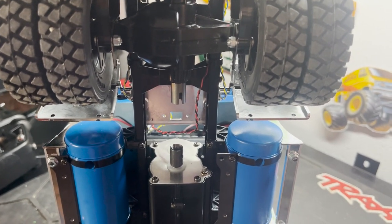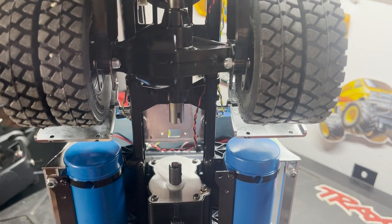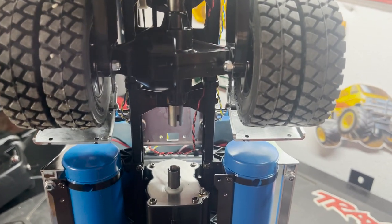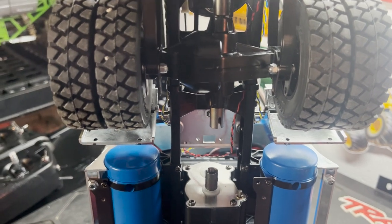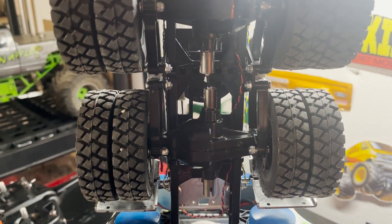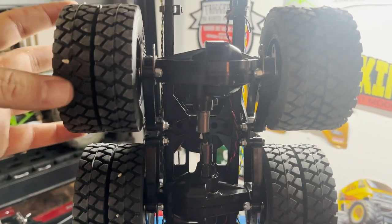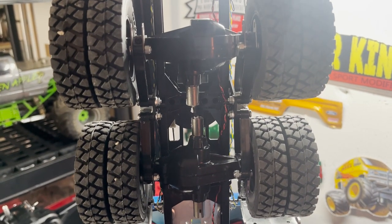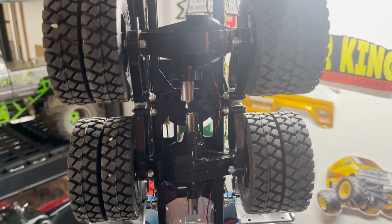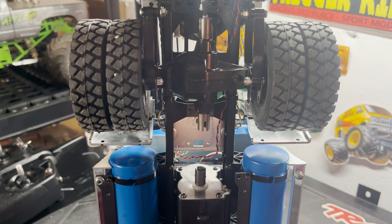I'm going to wind up getting some CVD style drive shafts with sliders. They actually make those and there's a bunch on Amazon and eBay. So I'll wind up picking up some drive shafts. Until then I couldn't really do much off-road driving because they want to pop out and I didn't use the shocks. Those shocks will actually help keep that in place — it makes the suspension sturdier so it can't pop out as easily. But given how I want this truck to articulate for off-roading, I have to have the articulation. Good news: the suspension does seem to articulate and these tires grip great on the limited trail running I've done. I'll fix that drive shaft issue in the next video.